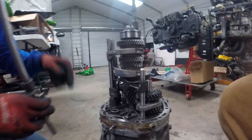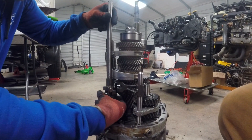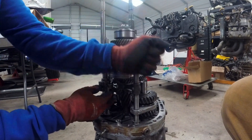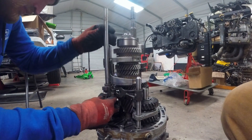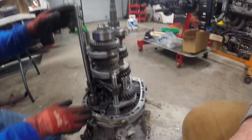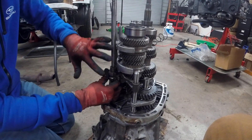Make sure these are lined up first, and then you can just slide this in there. Once it's in like that, it's kind of a trick — if that one goes in, this one also has to go in. If it's in multiple gears, it won't line up. This is a lockout system; it won't let any more than one gear be selected with this setup.